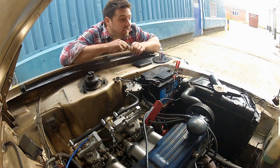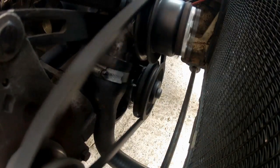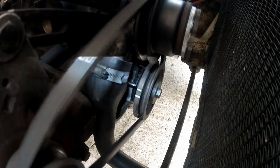Once you're happy with that, connect up the timing light, fire it up, and you're ready to adjust the timing. As you can see right now the timing is spot on, but for the sake of the experiment: if I rotate the distributor clockwise, I'm retarding the timing, and if I rotate it anti-clockwise, I'm advancing the timing. Back clockwise to set it to where it was before — and there we go, that's spot on.